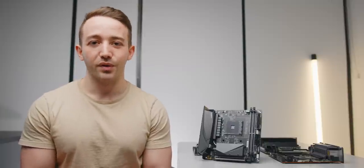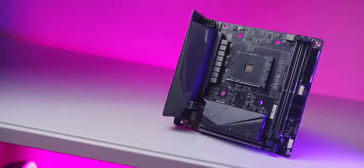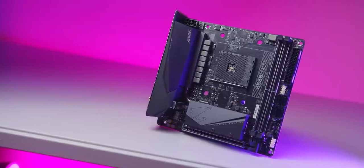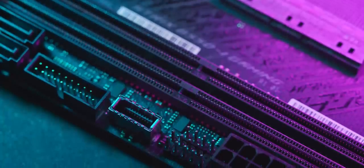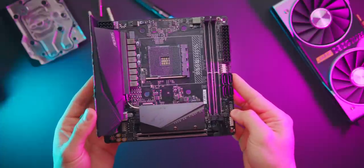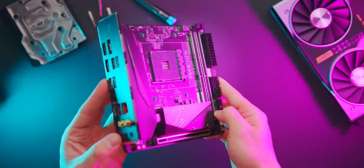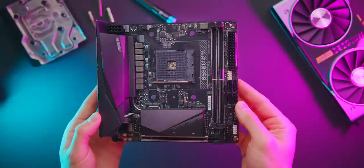So which board do you actually go with? The initial reaction is to suggest the Gigabyte B550i Aorus Pro AX — it had the coolest VRM thermals of any board tested, I personally like the BIOS UI for overclocking and fan tuning, and it's the cheapest of the four at around $180 USD while the others come in at around $200–$230. However there are two things I really don't like about it: it doesn't have a front USB Type-C header, which rules out cases like the NZXT H1, NCASE M1, or DAN A4, and it also lacks on-board debug LEDs which the ASUS and MSI boards do have. If you don't care about either of those two things, this would definitely be my first pick.